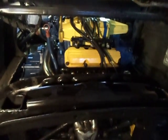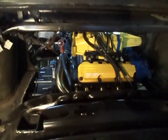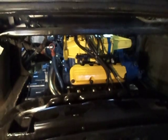It's a 3.8 supercharged engine. It's cammed, it's ported, polished. It's going to be pushing roughly 325 horsepower. We opted not to go with an intercooler on this engine. We have put AEM methanol injection on this engine to reduce NOx.